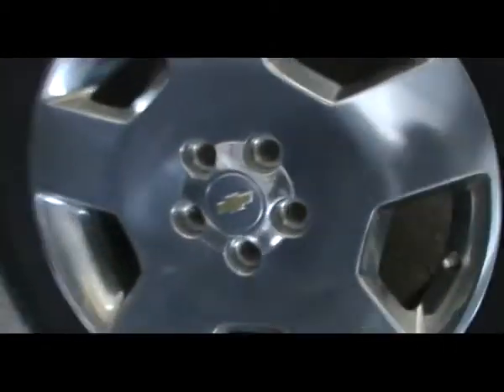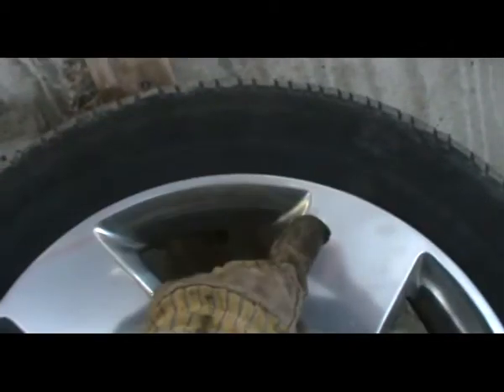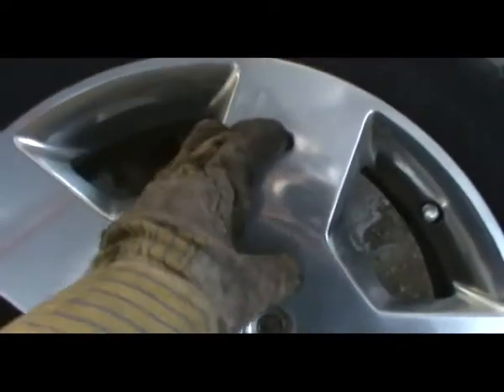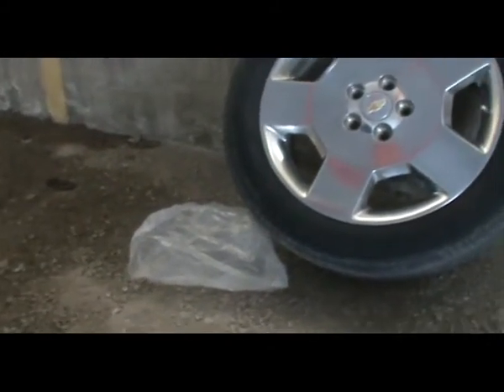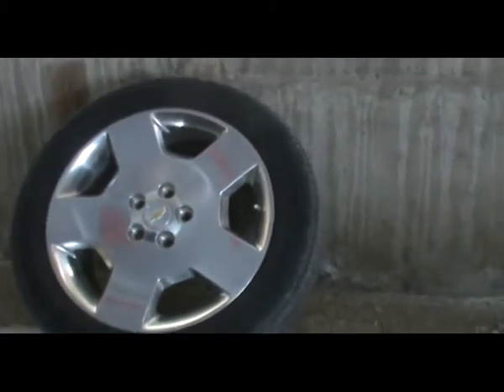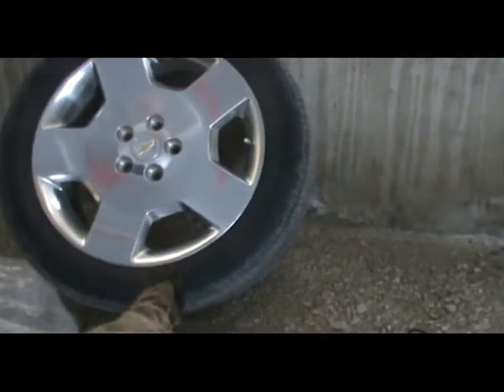Now, for the tire pressure system — you have this aluminum or metal wheel, and when you separate the tire from the wheel, inside the wheel somewhere there's a little metallic device, sometimes plastic, and that's the tire pressure sensor — there's one in each tire. I think they're okay. All I have to do is calibrate them: tell the car which sensor is front right, front left, back — so the car will know about them and it should work. If it doesn't work, we'll have to take the rubber off and remove that little sensor and replace it. Sometimes there's just dirt on the sensor and if you clean it, it'll start working.